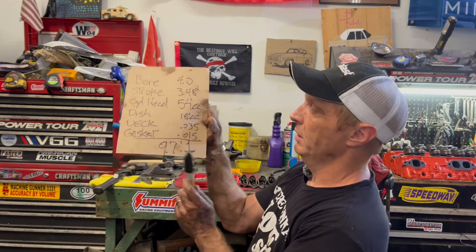9.7:1 is fantastic for me — I wanted to keep it under 10 but close to it, and 9.7 is pretty close. We've picked up 1.7 points of compression. Keeping it under 10:1 means we can run regular gas and don't have to retard the timing to compensate for pinging or detonation, because we've kept total clearance under 50 thousandths between deck and gasket. We've also got those 1.6 rockers on the intake, which may or may not do anything — and if they don't, eventually we can do camshaft and timing chain.